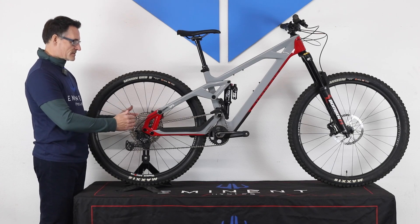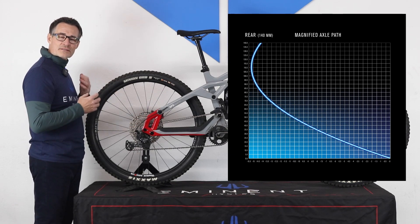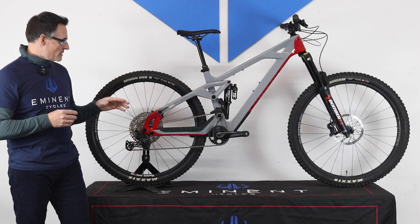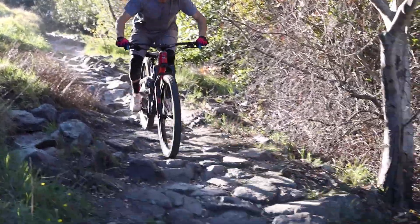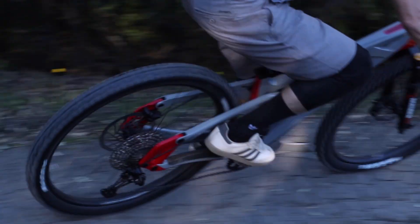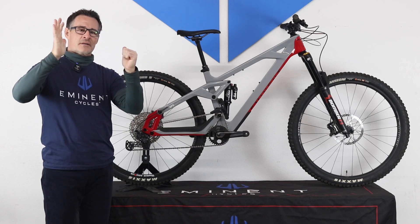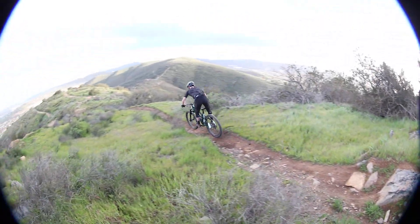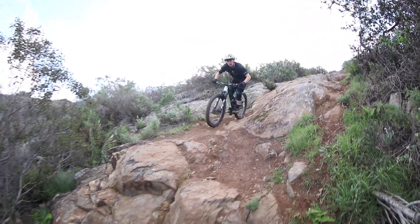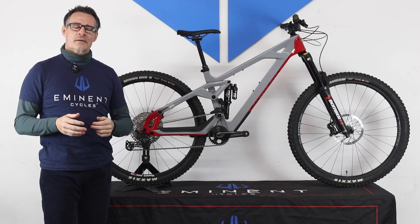Most bikes, the axle path is more up and forward as it compresses the suspension. Our bike actually moves rearward 15 millimeters as the suspension travels through its motion, and what that does is it allows the tire to track the ground as it goes across a bump. A square-edge bump comes rolling at your tire, and a traditional suspension that moves up and forward — the rear tire can't move back with the bump, so it's got to pop up and out of the way and land back on the ground, causing that jarring feeling at square-edge hits. With rearward axle path of 15 millimeters, the bump hits it and it rolls with the bump and doesn't pop up nearly as much, making the suspension softer and plusher, putting the tire on the ground quicker, and giving you better traction.